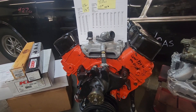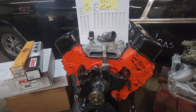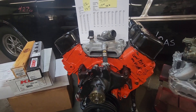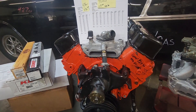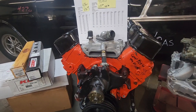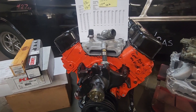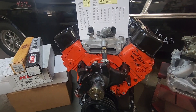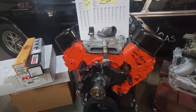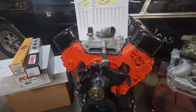The reason I'm such a big fan of this project: get on Facebook Marketplace or surf the internet and there's always a couple good deals on 396s. The 396s — if they're 1969 or older — most of them have a forged steel crank. If you want to keep that crank for a 427 build someday, great. But if you don't, put it back up for sale. Say you give $800 for a package of 396 parts — that crankshaft will get you $500 back a lot of times. You can get quite a bit out of a forged steel 396/427 crank.